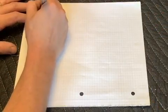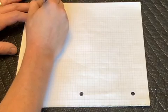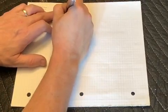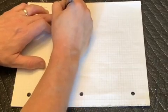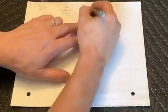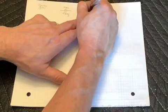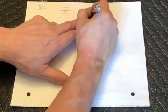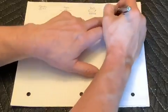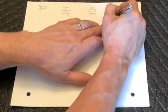So here we go. We're going to draw out our schematic for the power systems that we're going to need. The first item there is going to be the ignition switch. It needs to be able to obviously work in off, run, and crank. Next item is the MIL, or malfunction indicator light, check engine light. Third item is our DLC, data link connector, which is just your OBD2 port.